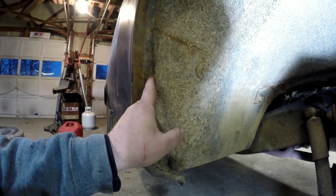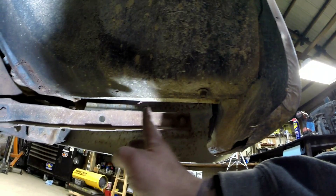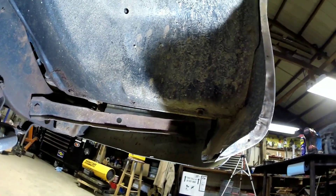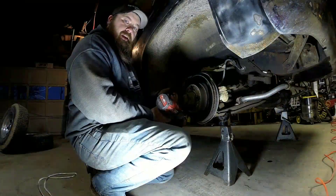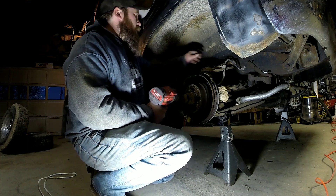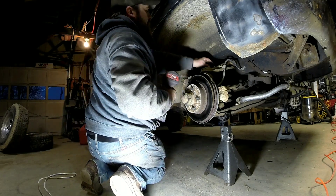Those are nine sixteenths; the rest of them I believe are half inch. You've got several that go along here — some of mine are missing — and one, two, three that go across the front on the bottom. There should also be a bolt that goes to the bottom of your battery tray, but mine seems to be missing too — so just less bolts for me to take out. I'm actually going to use impact sockets on my impact — moving up in the world.